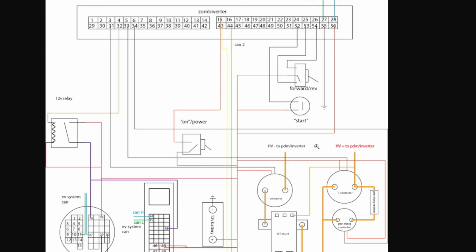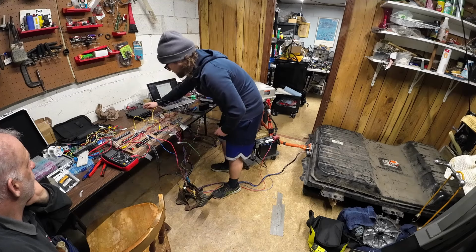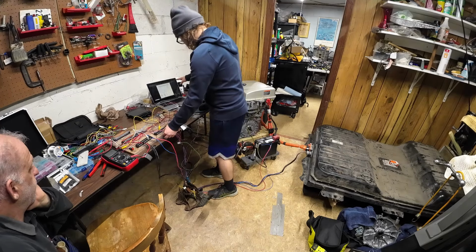When it comes to these contactors, we have our ground in and then our positive rail on the other side. Say we have wires 31, 33, and 34 to our contactors. It shows them going to the contactors, and then out of the contactor is a red wire going to 12 volts. Ours is going to ground. We assume that the 12 volts comes out of here. This acts as the ground, not the source. AKA, we're putting both terminals on ground. That explains why we have separate grounds.